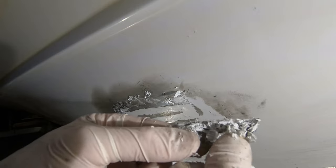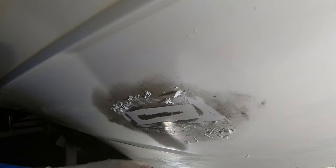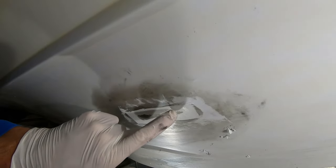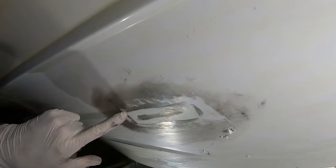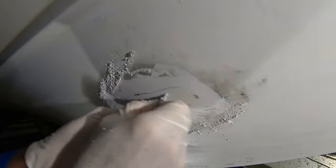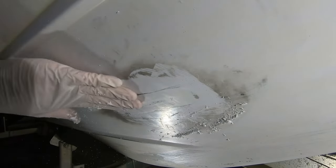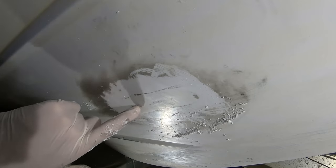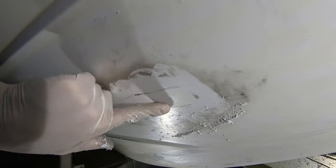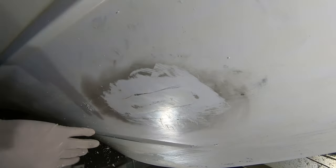You can see it is really taking a lot of material off of there in quite a hurry. You can really see where the low is and where the edges are. We're going to continue to take some more material off. You can still see it's a little bit low right there — that's where that guide coat is working for you — but we've really taken a lot of material off and smoothed it down.